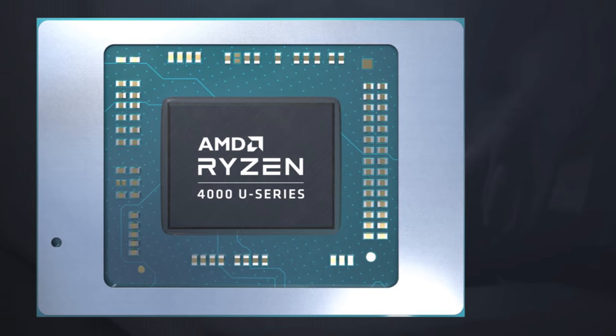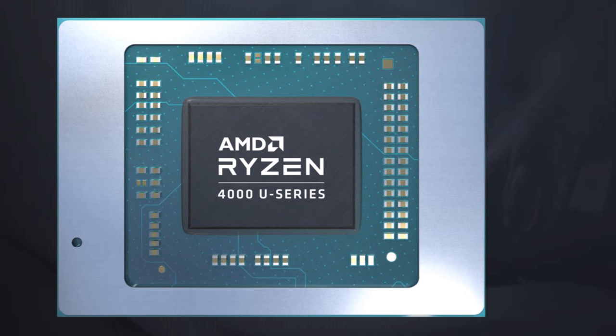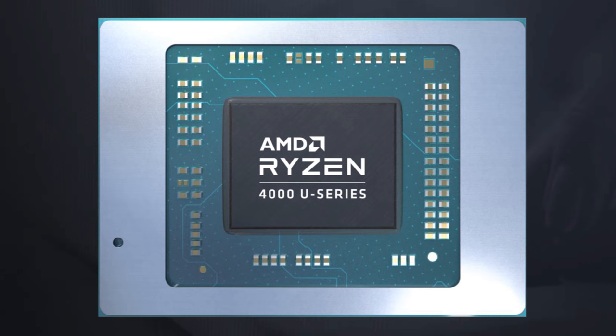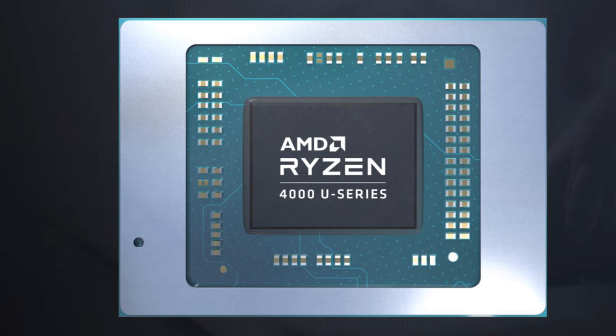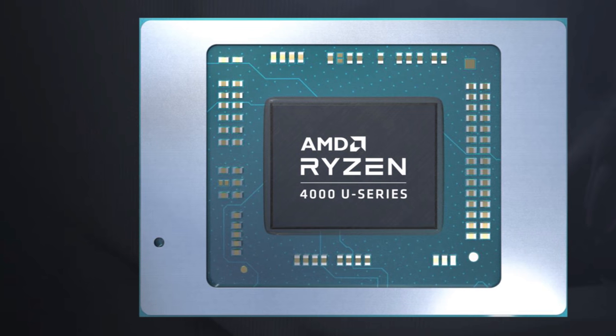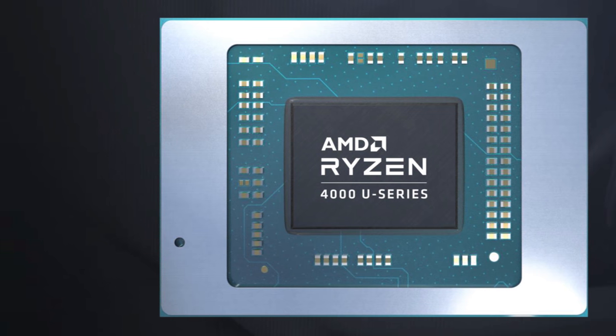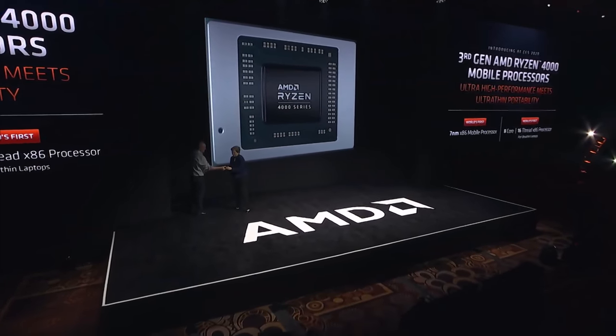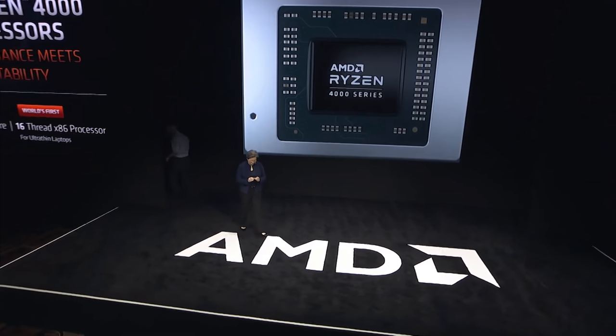Both should be using the same set of 7-nanometer hardware, just configured differently for the relevant products. So let's first talk about the die and the architecture. The bare bones we're seeing here is quite a bit different to AMD's Ryzen desktop processors. There's no I/O die here. Instead, everything is built into the one piece of silicon on 7-nanometer, allowing the entire package to fit into a smaller area, which is crucial for compact devices like ultra-thin laptops. So no chiplets here either. Some people thought AMD might swap out one of the chiplet die spaces on their desktop CPUs with a GPU die and call it a day, but no, this is entirely new silicon.